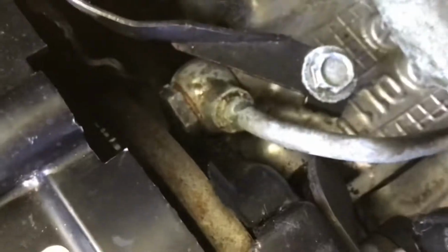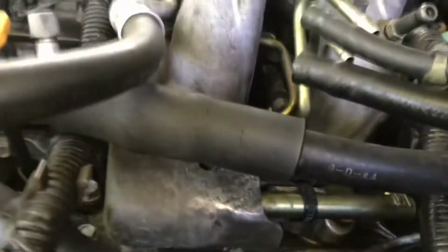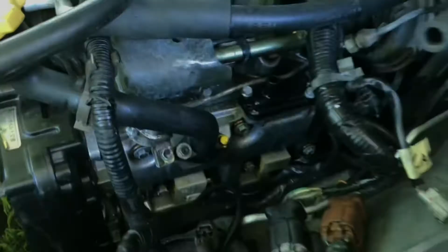And that's the hard line for the turbo, and it goes from the banjo bolt behind the camshaft pulley actually, down there. Even if you wanted to get that off, you got to get like a spanner on the end of that, or take the thing off. But yeah, that's probably the only thing. It's just that bolt there. The whole rest of the whole piece is ready to come off. It's just that one nut, so I've got to like push that down at the same time. But yeah, apart from that, everything else is going pretty good. Got this loom out of the way, so yeah.